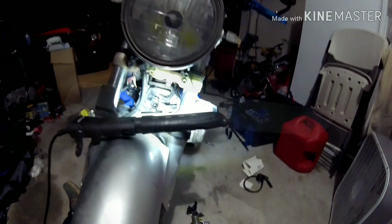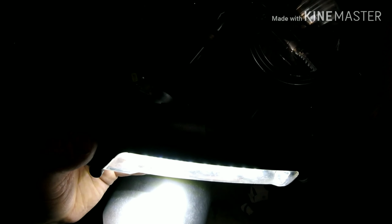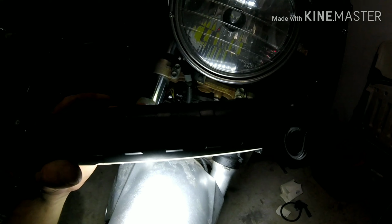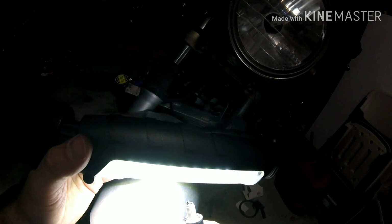That's fantastic. Really inspect that spark plug. It looks pretty dry. It was kind of dark. So that's good. It means it was also burning rich. So both cylinders are burning rich. They're not burning too hot, so it means they're not burning lean. So it burning rich is probably one of the reasons why it was cutting out. Very possible.